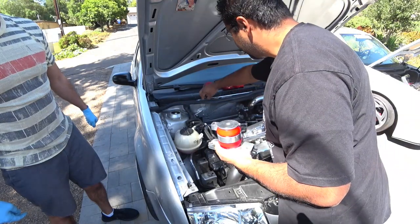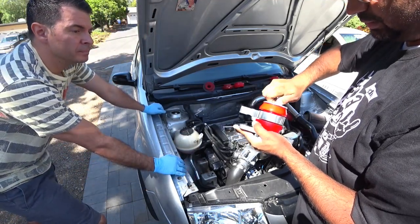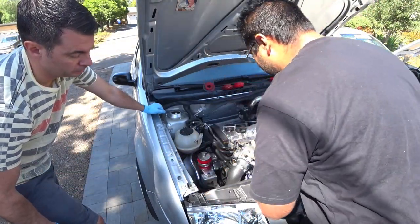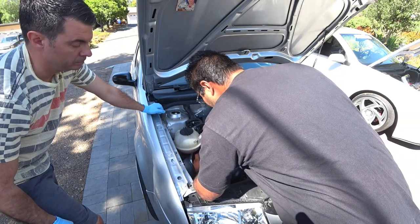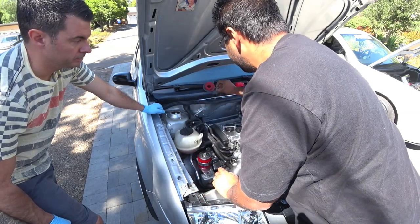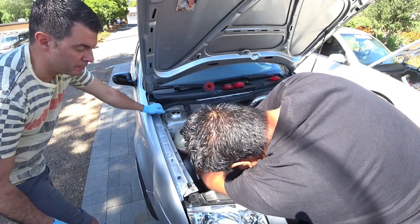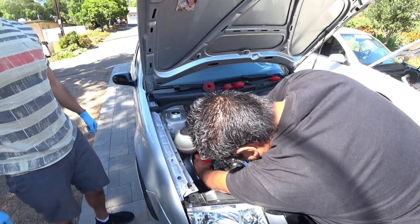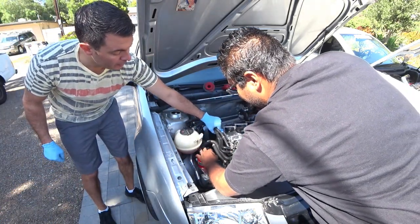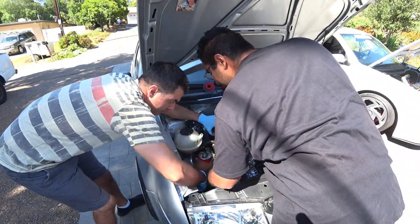I'm going to use this. This was the one that we used up here. Put everything by hand. Don't try to torque it down immediately. You just need to get it all started. As long as you didn't touch the motor and push it, it should line up immediately the way it was before. Maybe. Probably, because we messed around with some things. But remember, you have to put everything in by hand. Never use an impact gun or anything like that to start these, because you will cross thread these like nothing. These are easy to cross thread, so be very, very careful.